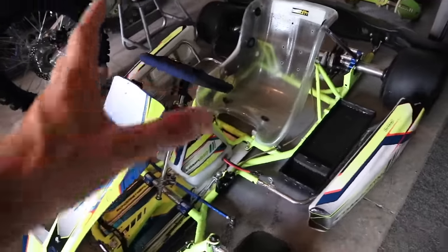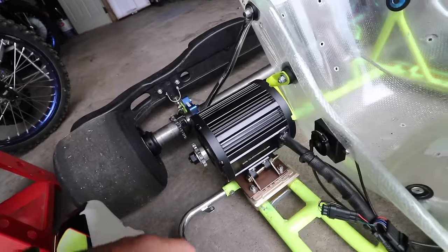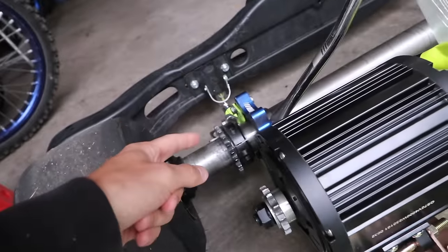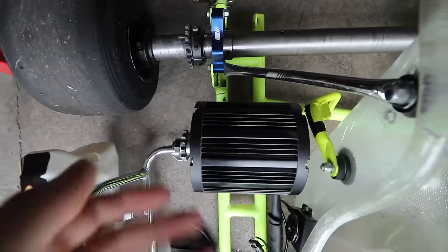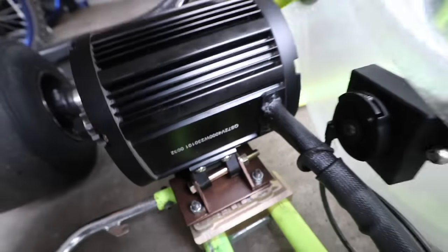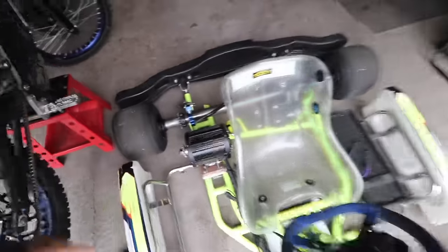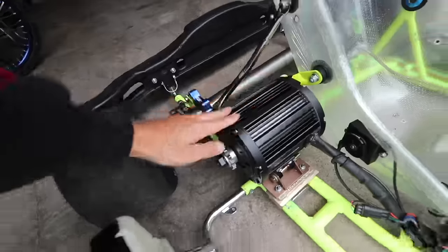Once again, thank you to Electro & Co for the motor and controller setup under the tank — I'll leave them linked below. Well, I spoke too soon on the chain. Last night Joe came by to test it out — 30 seconds in, the chain ripped off due to the amount of torque, probably because of the smaller sprocket pulling so hard compared to the bigger sprockets. So it's back to the drawing board. The chain got out of line, the motor twisted, and it completely sheared off the sprocket. I'm waiting on a new one — I'll probably go back to my first idea and put the plate on, because this aluminum just isn't strong enough for how much torque this has. I'll be back in a week or two with the next video. Subscribe, throw a like on this video, and give me some ideas on different vehicles I could build with this electric platform — I know we can build some really cool stuff.